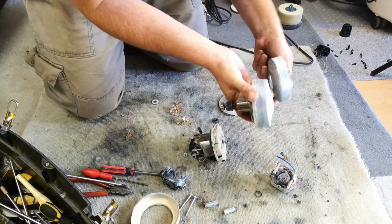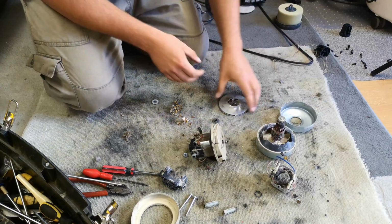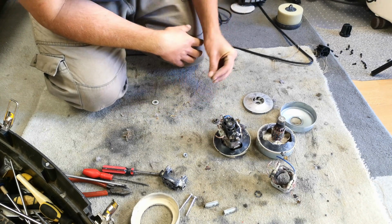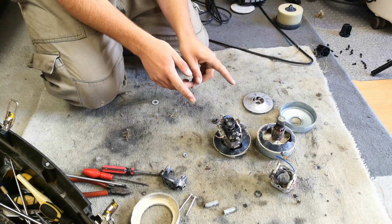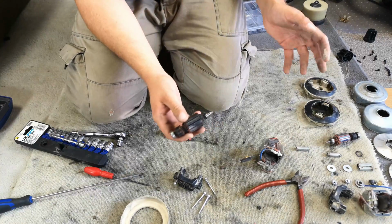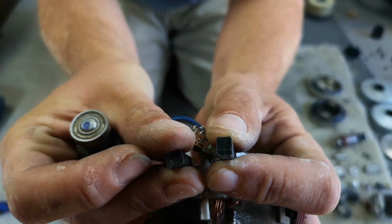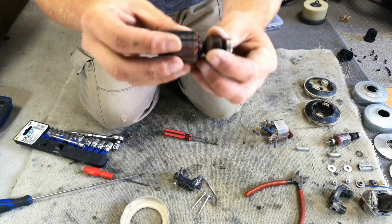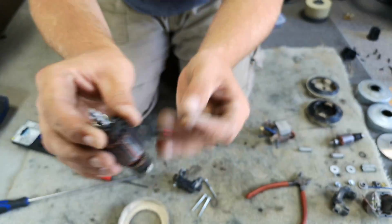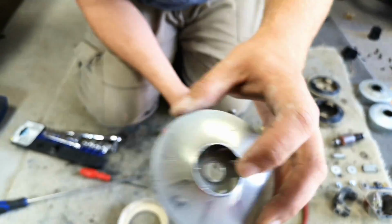But, I mean, yeah, they're both identical motors. Of course they are. So, what I was perhaps thinking of doing in this very video is making one good motor out of two. Now on our second motor, the carbon brushes are in really good order. So it needs cleaning up, but so does the commutator. What basically happened, I think, is this bearing exploded, possibly at the same time, or leading then to this happening.